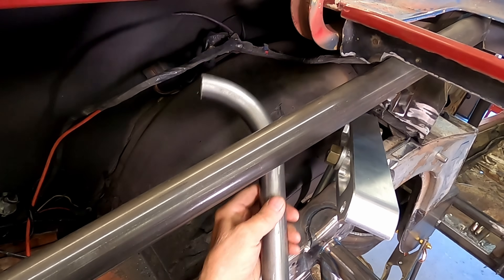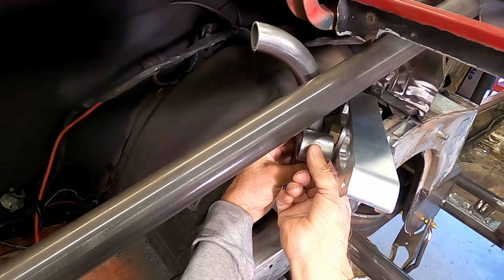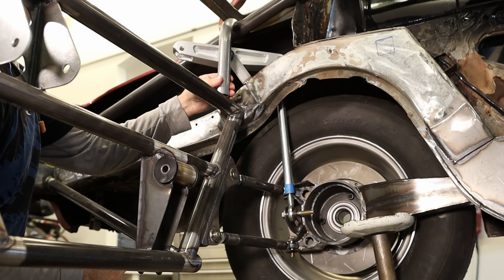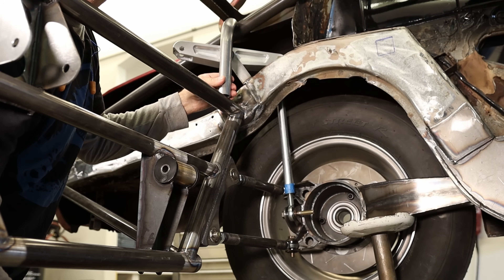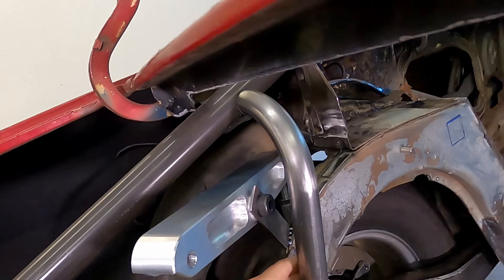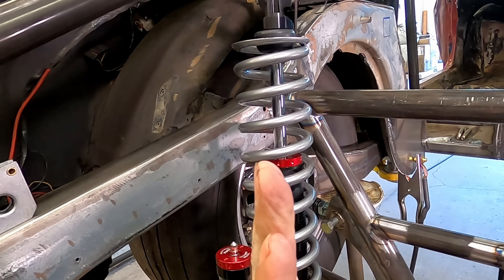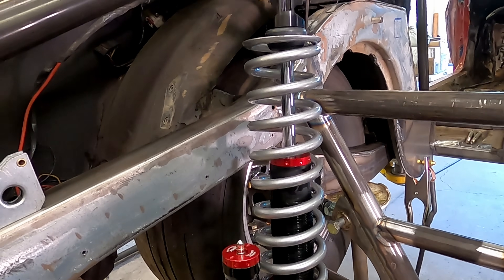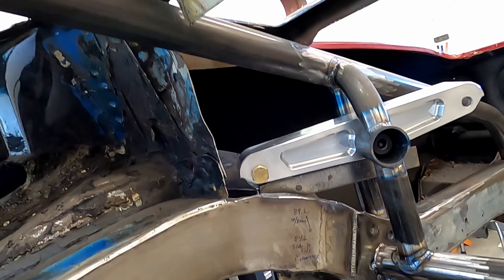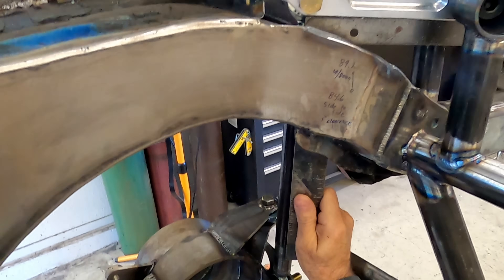I think it's the most elegant because it's round, so it doesn't accentuate the angles. And then on the back side, it's probably just a straight part with a spud on there to put the bolts — I think that's going to be the plan. The shock has a couple of angles to deal with. One of them is the side angle, which should be about the same as the 4-degree push rod angle. Both the shock and push rod should be at 90 degrees to the hinge point on the rocker at the right height. This will eliminate any progressive or regressive shock action.